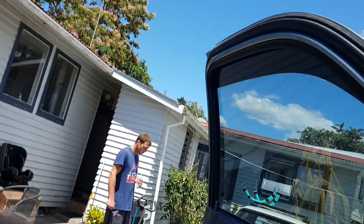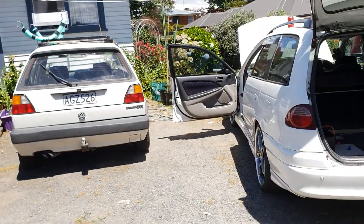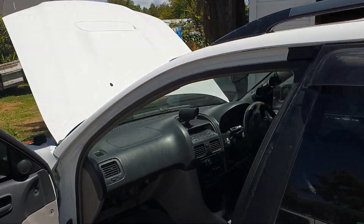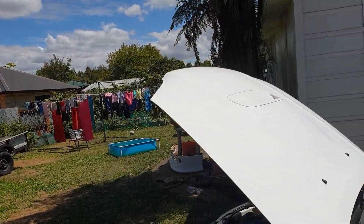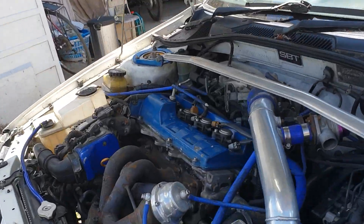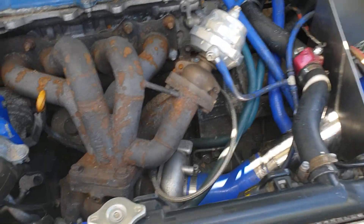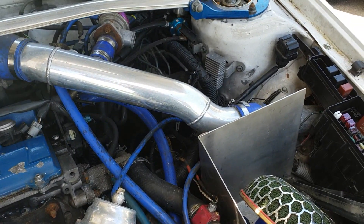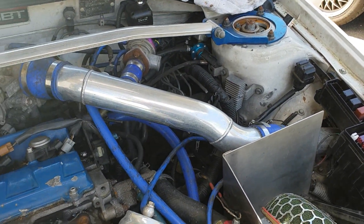I know I've done earths before on a KZ powered Prado, but this one is doing a few weird things when I got my test light up, so let's have a quick look. We have a ST215 Caldina with a different manifold fitted and a few bits and pieces under the bonnet. It's just had the gearbox out and I did suspect it had an earth off.